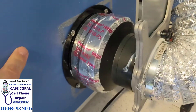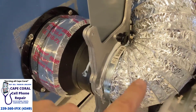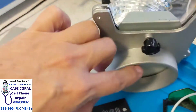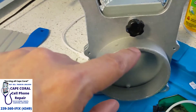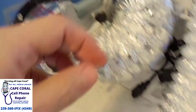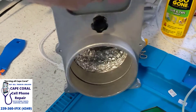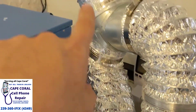I wanted to show you the trapdoor we have set up here. While the machine is running, this trapdoor is open, allowing the air to go through and exhaust to the outside. On the other side, this one is closed — this is the one we'll use on our blue mat when working on the phone. Once the work in the machine is done, you just turn this and allow the door to come down, then open the other door and tighten the screw so you exhaust only from that side.